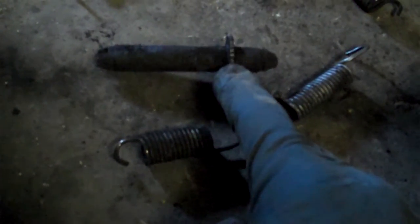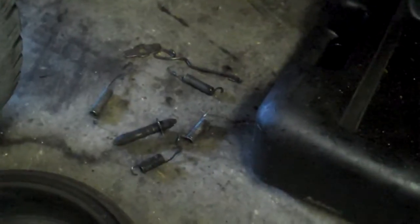I just lay that into place. You see this spring has to go this way so that — see how it's got a little hook that goes around? That's to clear this little screw. That screw corresponds with this little foot here. Every time you reverse and hit the brakes, it'll make a little notch on that and it'll turn this — it'll actually expand it. So according to which way that screws, that's where that foot goes.